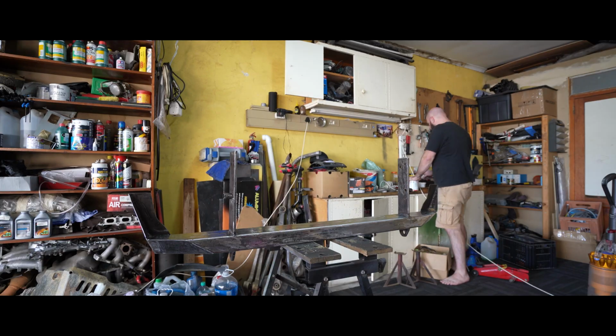So what I'm going to be doing with this one now is there's a local product that we get here in South Africa called Fussbait. It's an etch primer that is really, really good, and I think that's what I had on here originally, and that's why I struggled so much to clean this other bumper. So I'm going to stick that on now. Hopefully that will dry fairly quickly, because I'd love to get a coat of paint on this before this evening pops in, so that no surface rust appears.